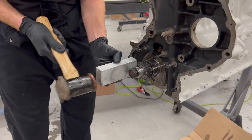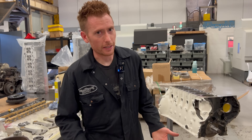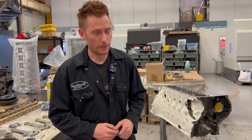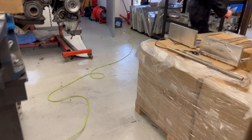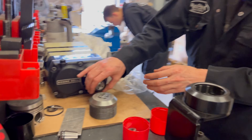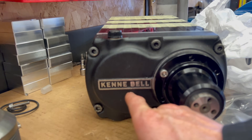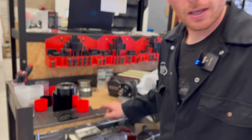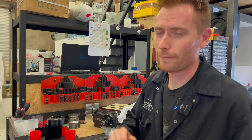I'm certainly going to use the dowel pin especially whilst trying to run a supercharger — I'm going to have that extra force on the front of the crank and I really want that extra bit of traction on the shaft. Would you like a little treat? It's a bit premature since the engine is still being built, but would you like to see the supercharger? Come on, look at that! Anyone that's seen one of those before — type the brand into the internet this afternoon and have a listen.